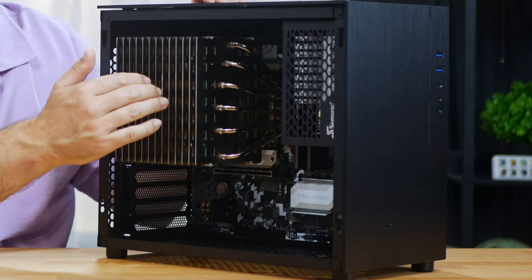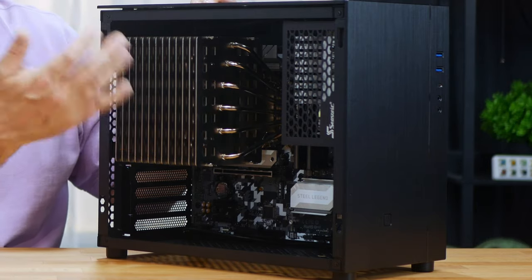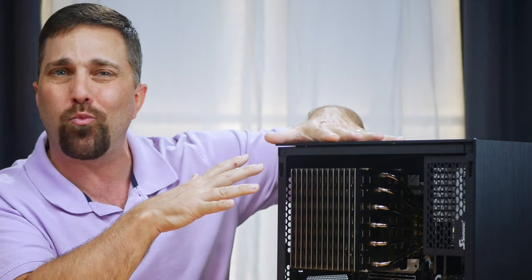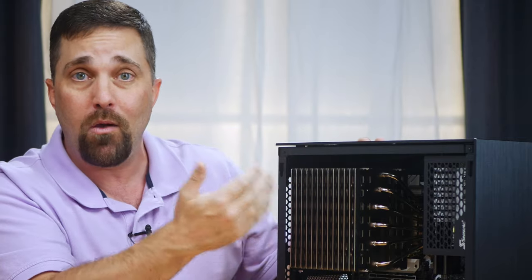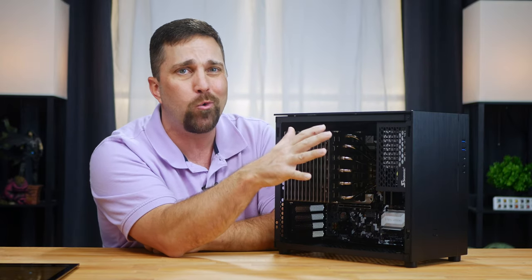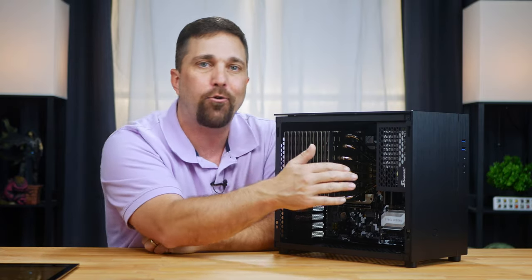I was a bit concerned that the Noctua may radiate heat into the PSU, causing it to heat up more than it would otherwise, but honestly, the heat the system was putting out was just limited to right here above the heat sink. So it was working exactly as it was designed. Plus, the PSU was only pulling under 200 watts at max, so it wasn't having to work hard and generated almost no heat.